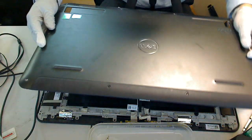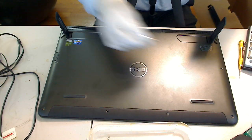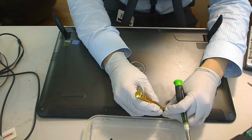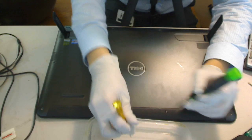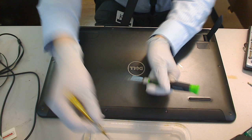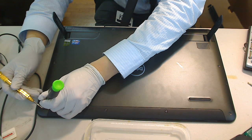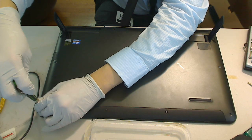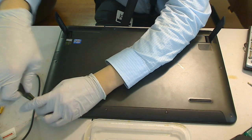Put the top cover over, matching the top first. Switch your screwdriver to hexagon. So to screw the corner screw in, you want to push down the case until you hear a click before you can reach the screw.